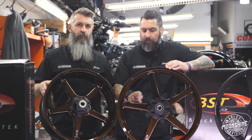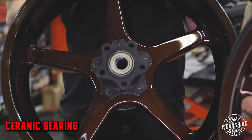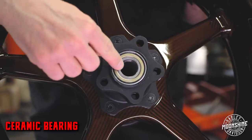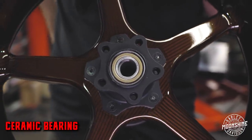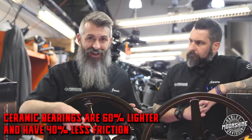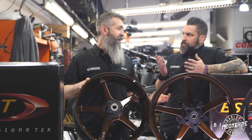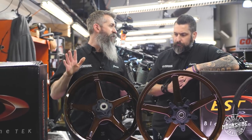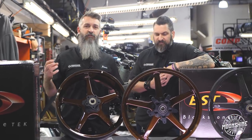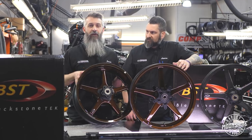If you don't want to advertise the fact you've got a carbon fiber wheel but want all that performance, you can get a plain flat or gloss black wheel. When we order the rims, we have an option to go with ceramic bearings instead of steel — we have yet to install a set without the ceramic option. It's a hybrid ceramic bearing: the races on the outside and inside are steel, and the ball bearings inside are ceramic. The difference is they are 60% lighter, have 40% less friction, and can handle 2,000°F before they start to swell and distort, whereas steel bearings are only rated to around 300°F. So the ceramic is definitely a plus.